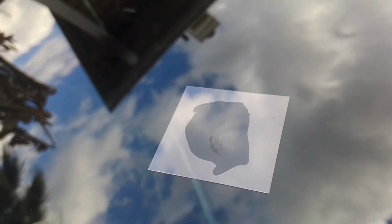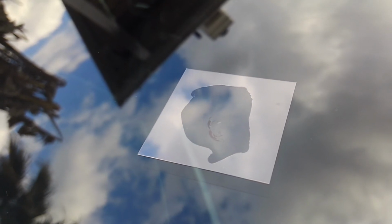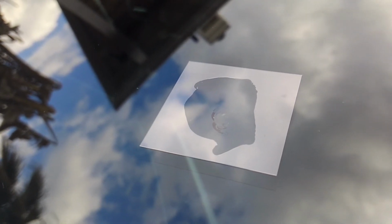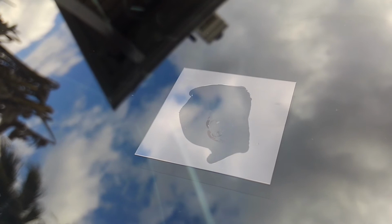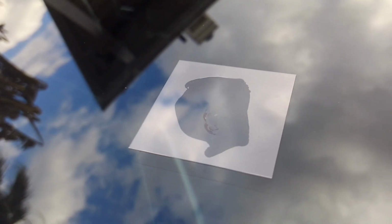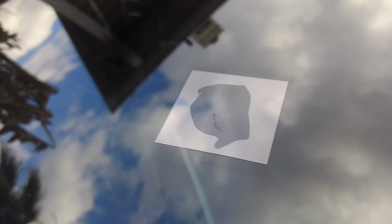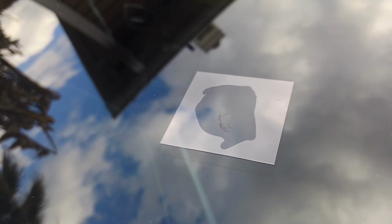So you can still kind of see it didn't 100% diminish the appearance, but it definitely looks a lot better than it did. So we'll clean up that excess pit filler that's going to be on the surface of the windshield, as you can see. So it would be like a mound right now. So we'll clean that up with a straight edge razor blade and then polish the finished product, polish that little bit of resin that's filling the hole. So we'll show you that and finish up the video in just a second.